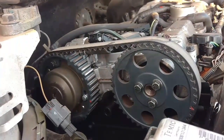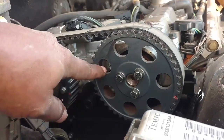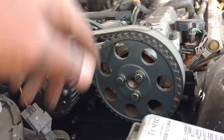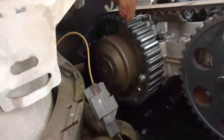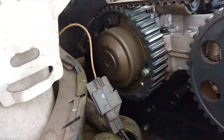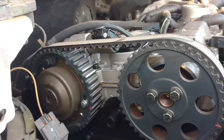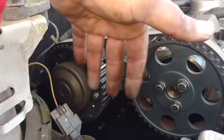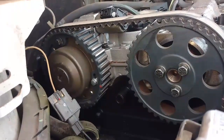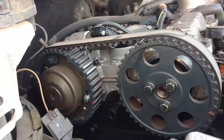A lot of these cars have different configurations of these hubs. This is a solid camshaft gear — this is what was used from '92 all the way through '98. A million cars use them. There's nothing special about it. This right here is a variable timing cam sprocket. If you have one of those on there, your engine is considered an RN motor. They started putting RN motors in starting in 1999. There are several configurations — hub on the exhaust cam, hub on the intake cam, whatever it is. If you're going to take one of those hubs loose to fix an oil leak, you need to have the proper cam locking tool on the back of the engine, or you're probably going to mess something up and destroy somebody's engine.